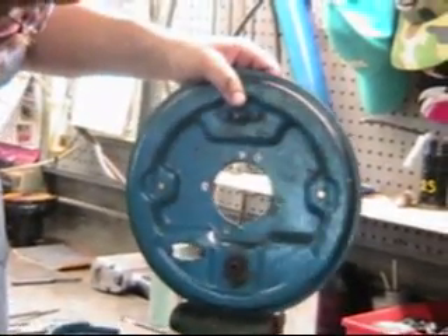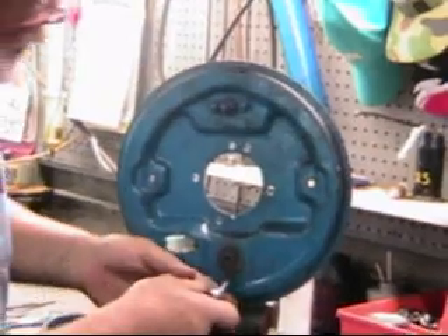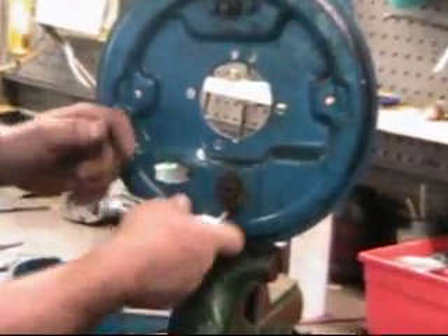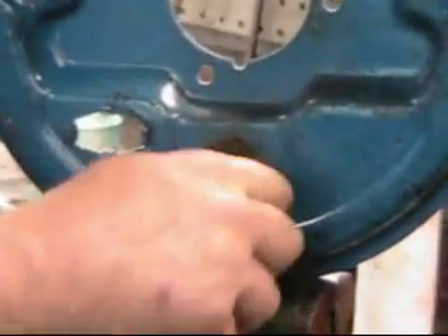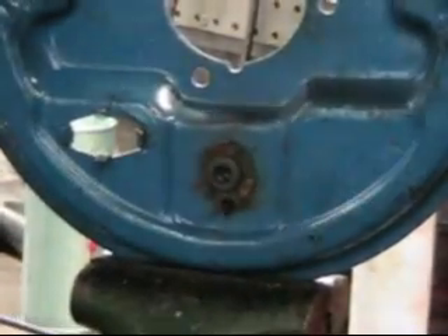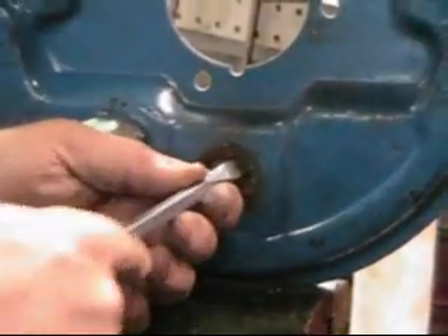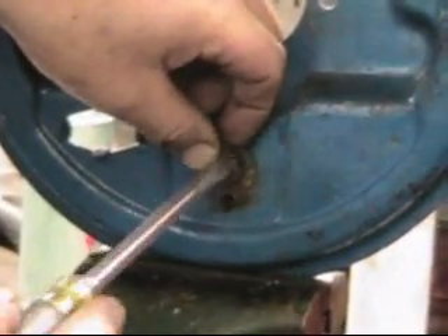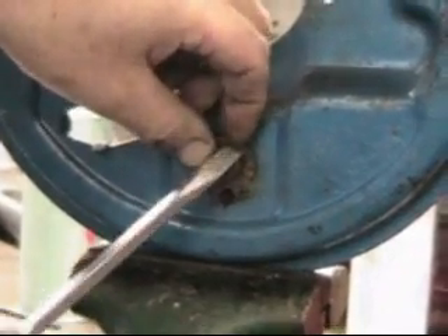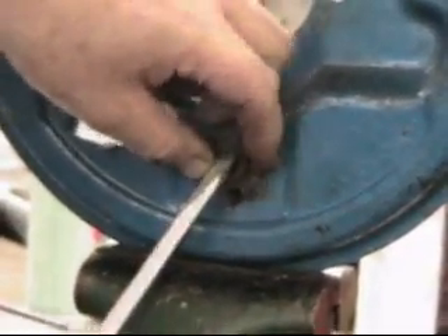Let's take a look at our cylinder here. A lot of people say, how do you get the cylinder off? First of all, you take the bleeder out. Remember there's two different sized bleeders - there's the 5/16 bleeder, which is the original size, and most replacement cylinders are metric, coming through with a 7mm. Then we can pop our clip off. The clip is off and now the cylinder can come out from the back.